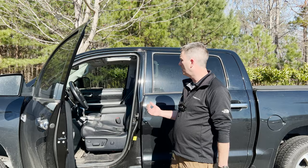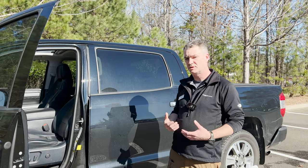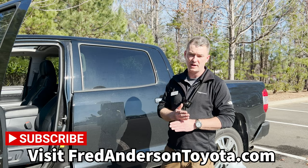This was done here on our demo truck today. This will work on any car that we have on the Toyota lineup with a sunroof, so make sure you just flush your drains out periodically after a car wash to make sure that grit is cleaned up. If you ever do pour fluid into your drains to check them and you notice a blockage and it's not coming out on the ground like we suggested, please stop. Do not add compressed air, because if you do try to clean the drains with compressed air, it typically blows the tubes off, and you find the water going into places we don't want it to go.